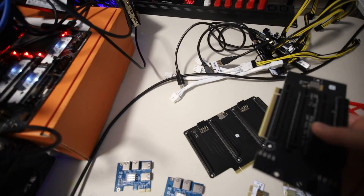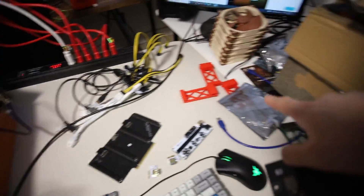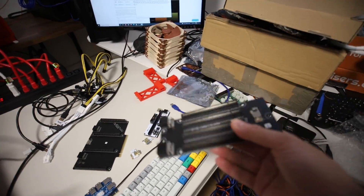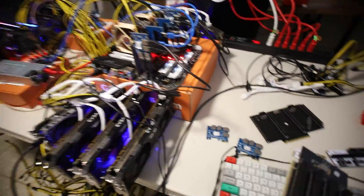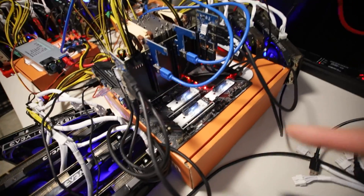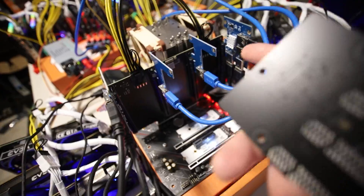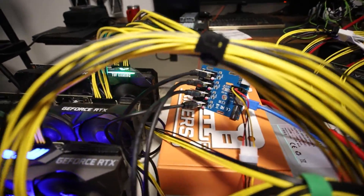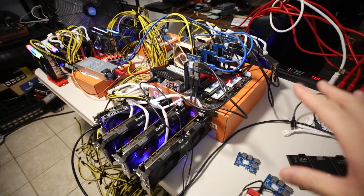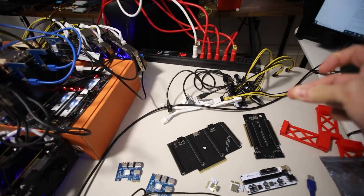I'm going to add another four GPUs here and another four over there and see if that works. For the future — and I don't want to get ahead of myself — if I could find an x16 ribbon cable to extend it to another table, maybe I could do 32 GPUs if I get 24 working. But for now I just want to concentrate on adding another bifurcation card and hopefully it will distribute PCIe lanes correctly on this other x16 slot. It's just incredible that this works. Let's see if we can get 20 to show up in Windows — three, two, one.